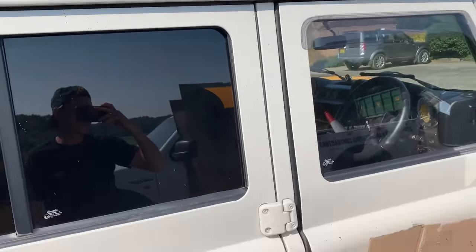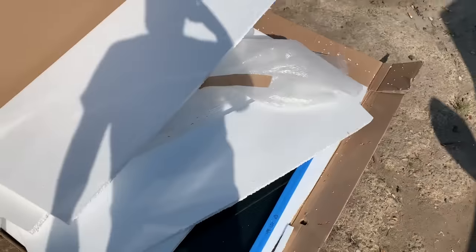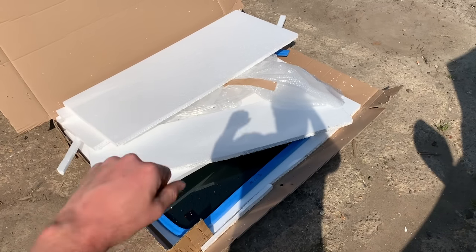Oh yeah, I put the frame on the roof. I have a frame, which is going to be sitting somewhere around there. And I have our double glazed, toughened, laminated glass roof. Now this is double glazed because if we had single glazed, it would do the typical Defender stuff of attracting condensation during winter months and leaking all over the nice interior.